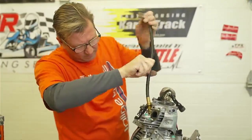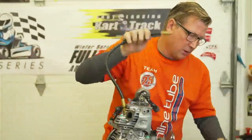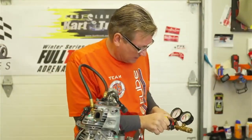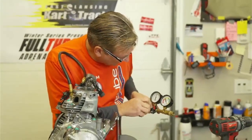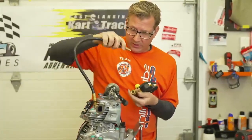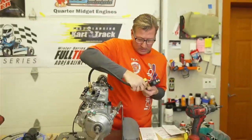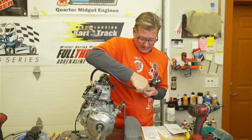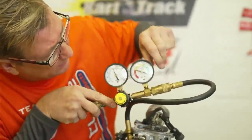100 PSI is a lot, so you're going to have a little bit of leakage. We have one gauge set at 100, which you can adjust with this knob to get it exactly right. It's going to push the piston down into the bore because there's nothing on the crankcase to hold the piston, so I plug it in slowly. As you can see, there's a zero on the gauge and it's just off zero.